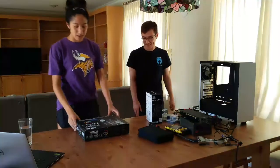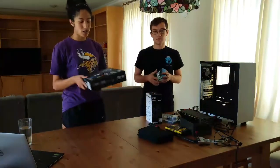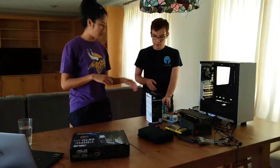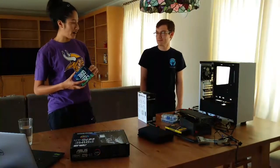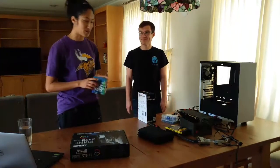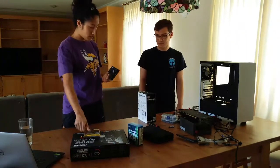Alright, so for today's build, I guess we start out every build by talking through what we have. We have this awesome Z270AR motherboard donated by an awesome colleague of mine, Doug. He also just joined the team just like I did, but he knows a lot more than I do. So we are building an i5 7600K, so an i5 with overclock capabilities, which is VR ready, which hopefully I make use of this summer. A 2x8 DDR4, 16 gigs total, so 2 slots on the motherboard.